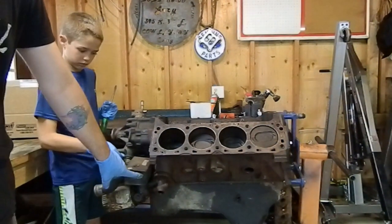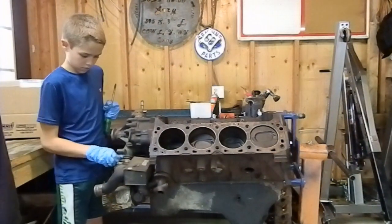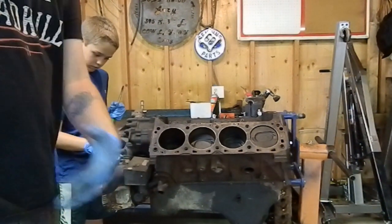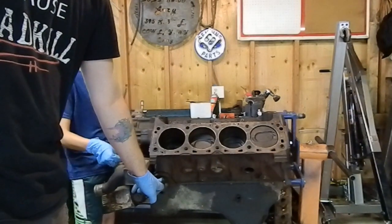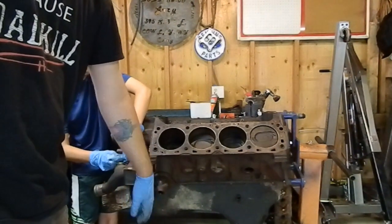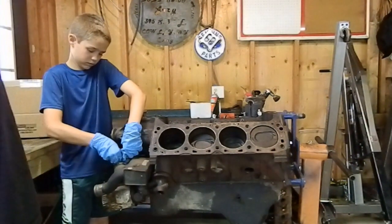So if you see one of those and you're like, what is that? I don't know what to do with that. It won't work on this engine. Take the bolt out of the middle, undo it from the radiator hose, and you can just pull it all off. Get yourself a filter bung that'll fit right there, and then an FL1A filter will screw right onto it, or a Wix 51515 or whatever it is that all these old Fords use.